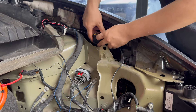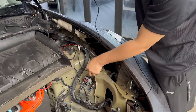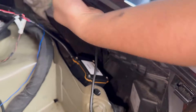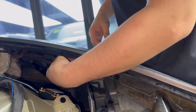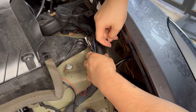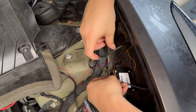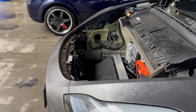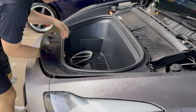Once you've done the hardest part — getting access from the front trunk to the interior — everything else is easy. This is the center module, the main sensor box. Tape it down using the included double-sided tape right next to where you'll install the sensor. The sensor itself — find the right spot by knocking to test, then tape it right underneath the front trunk aluminum part next to your headlight. Now just organize all the wiring to keep it neat and clean so you don't accidentally pull any wires.